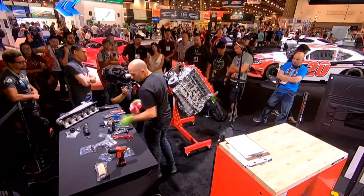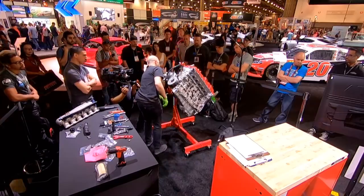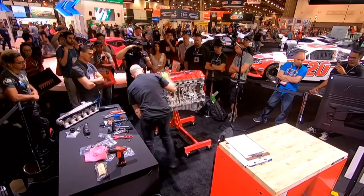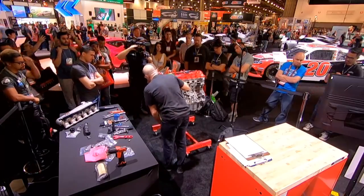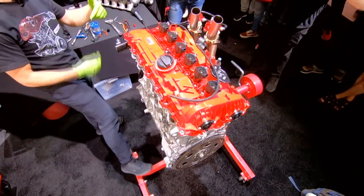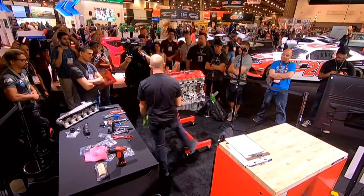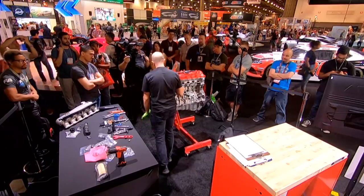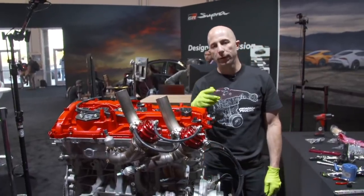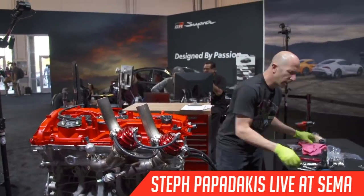I got tools out everywhere. Good. Yeah, we haven't had any problem with any kind of oil drain issues. We found if it's just somewhat downhill, it's usually good enough, and if it's large enough, then it needs to be entering the pan above the oil level. But different engines, different turbochargers can have different varying degrees of the needed feed versus drain. All right, next, let me clean up a little bit.